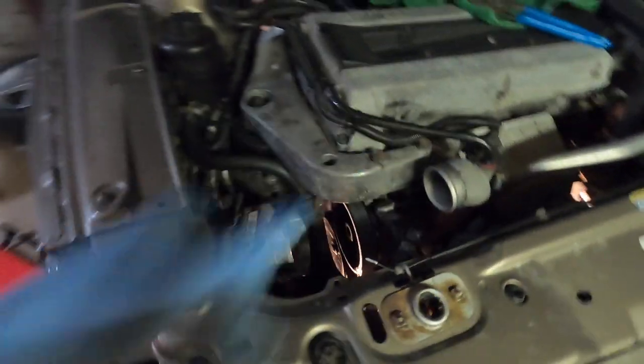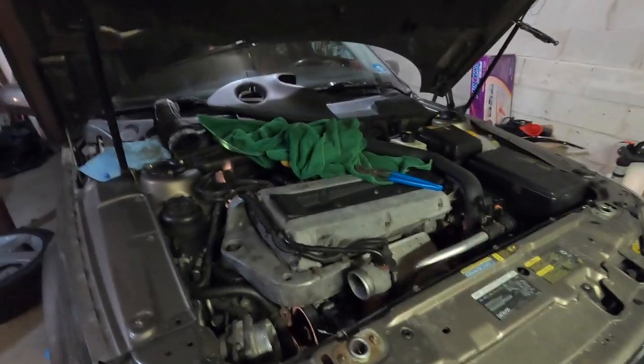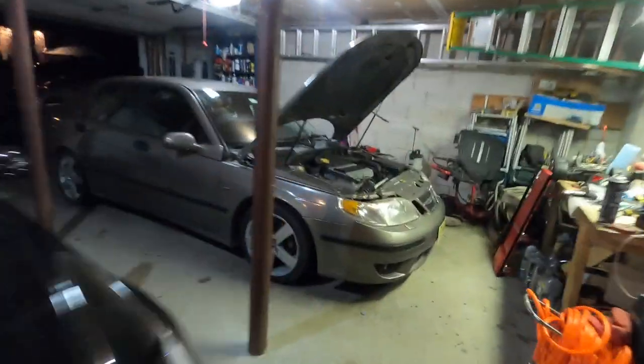Belt is on there — 36 foot-pounds of torque on these aluminum bolts. I just hand-tighten this down with a little breaker bar, nothing too extreme but a nice little yank. So I'm going to go ahead and reassemble this, change the oil — it's getting late, so I'll call it a night and wrap it all up tomorrow. We got oil in there; I'm just going to give it a quick start here before I go home to make sure she's running good. We've got 222,700 on the odometer — I'll mark the oil. Sounds perfect. 222,700. We did it right.